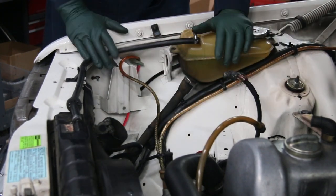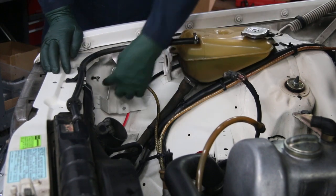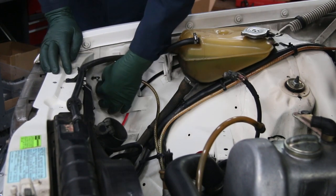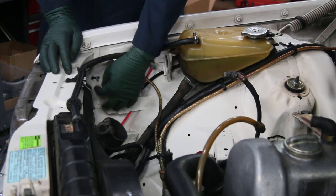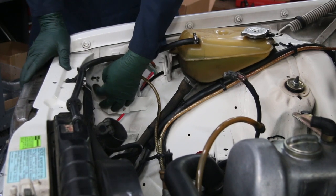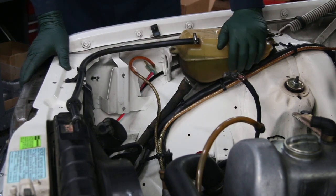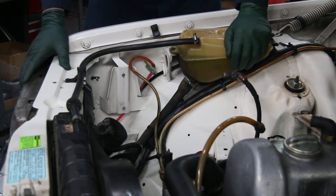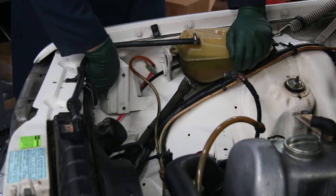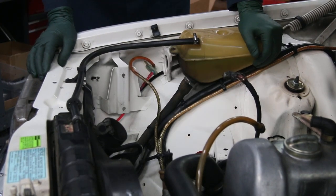It's nice to have a clean car when you go to work on it. While I'm in here inspecting things, look at this — guess what's missing? A little plastic locking knob for the front right turn signal assembly. If you leave those off, this thing could fall off going down the freeway. I've actually had reports from customers saying their turn signal lens fell off on the freeway — that's why somebody forgot that knob. You'll be surprised at what you find on some of these old cars, even if they've been really well maintained like Casper.